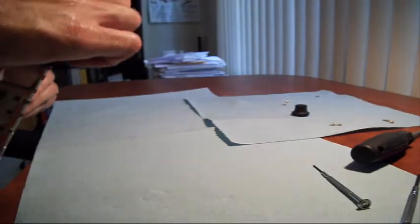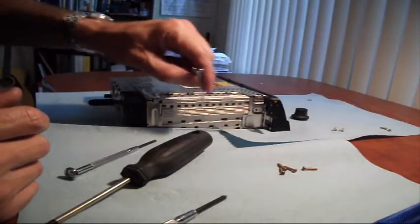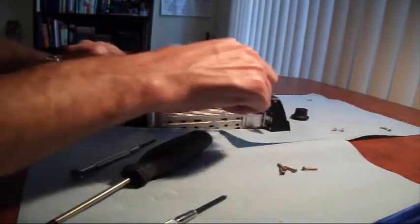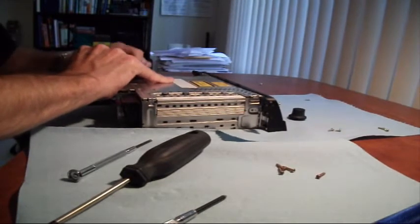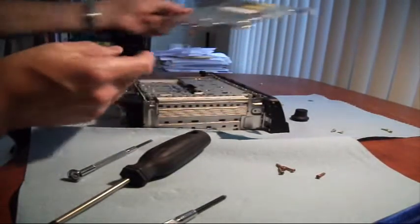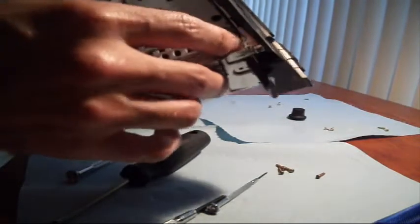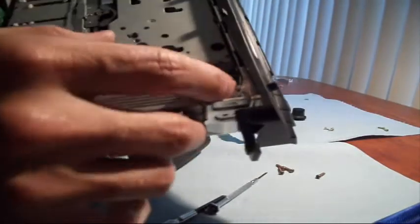So now we're still working to try to get this whole plastic thing off. I just went around this thing and took out every single screw I could find — there were screws along here, a couple on the top side around the perimeter, and one on the back. And now I'm going to take this shell completely off because I want to see what's inside and how I can gain access to all this stuff. So I guess we just pry it all apart. Alright, so that's off. We can see what the problem is now — this is loose. It looks like this broke and cracked away. This is just flopping around. So we've got to somehow put a longer screw in there, or glue it, or something like that to get it back in place.